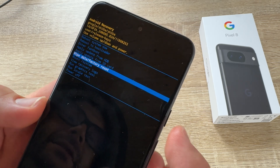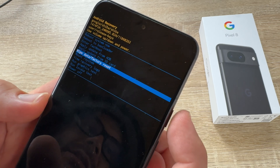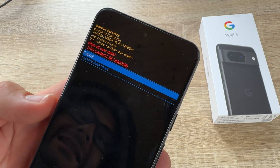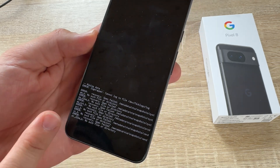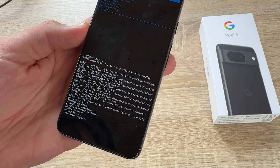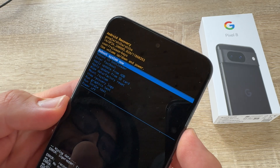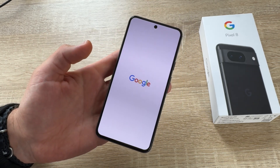The other device setups we can make for troubleshooting or for rooting, for example. We enter with the power button and now we get an information: wipe all user data? This cannot be undone. Yes, of course we have to. So now we go factory data reset. You see some operations — it is formatting everything and now it's done. Our data are gone. Now we have to go to reboot system now, pushing the power button to perform this. And now it is restarting.